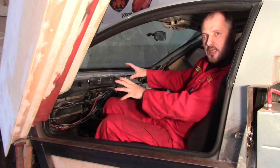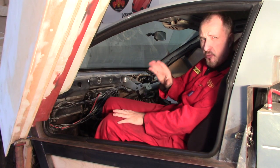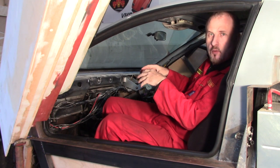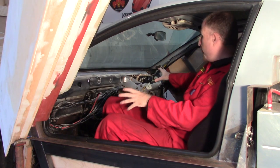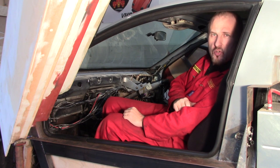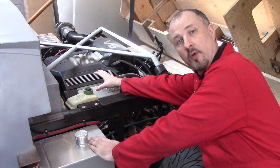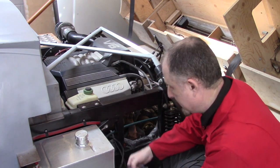Much of this loom you see here is from an Audi A6 C4 and it follows pretty much the same pathway as on the original donor car. What I've actually done on this prototype is I've moved the engine wiring harness to the rear of the car, and the rest of the wiring loom is laid out as on the donor car — and that's not as difficult as you may think. The wiring harness from this engine is only connected to the rest of the wiring loom through a handful of connectors.